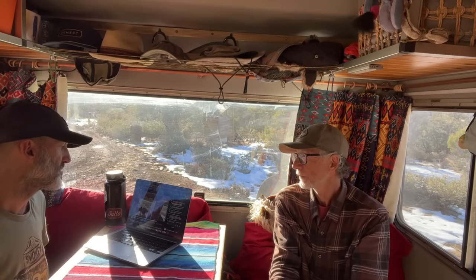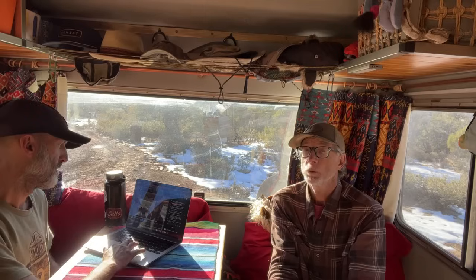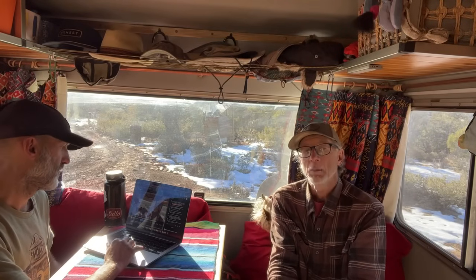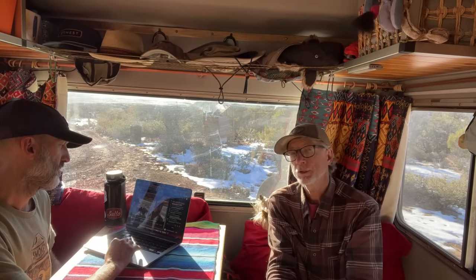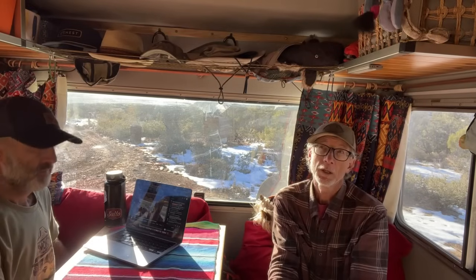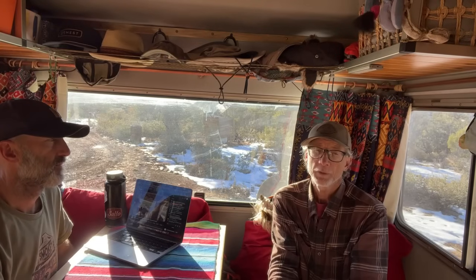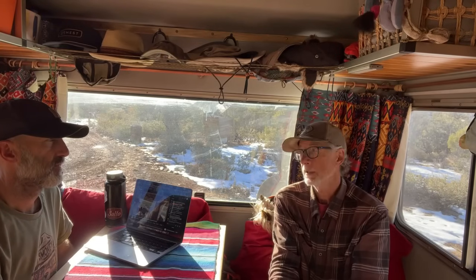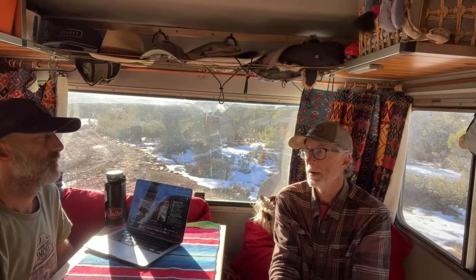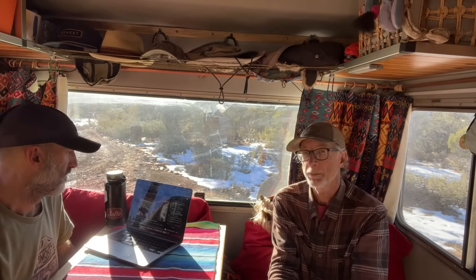Let's see here. Sally's asking, "Brad, how much solar do you have now and how long does it last you?" I have 365 watts of solar panel and 200 amp hours of lithium batteries. Nice. I don't have any electric cooking appliances, so I have plenty. I've been in a buddy's garage where I was in there for 4 days and I completely ran out of power. But I did not have a DC to DC converter, so I now have that as a backup. So I can always start my motor and at least put some power into it.